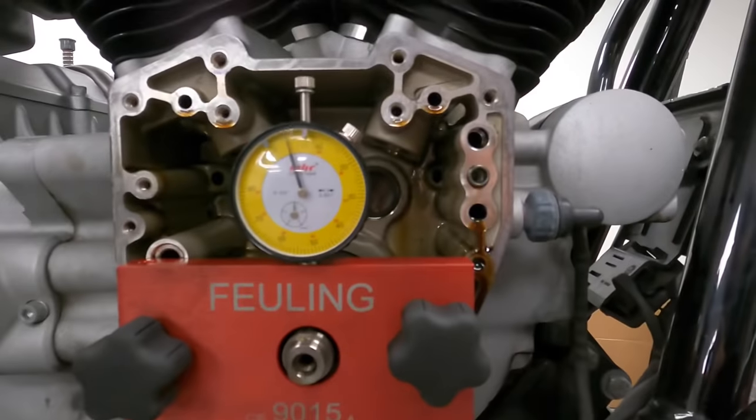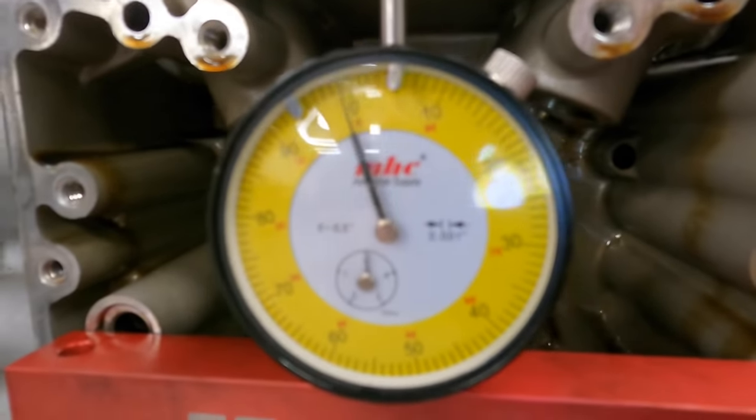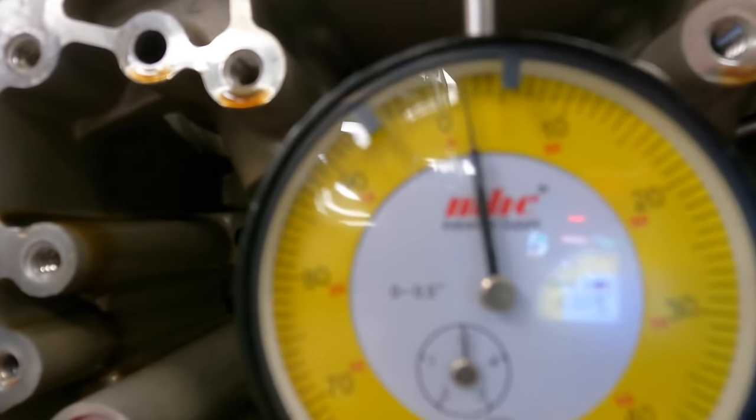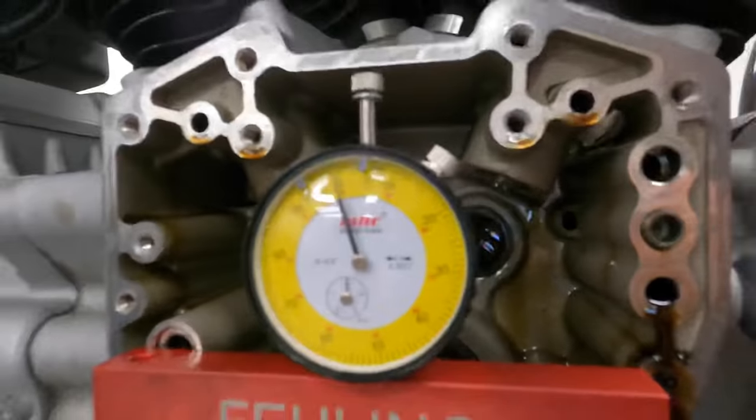This is to check pinion shaft run out — it tells you if the crank is true. That's why I took the spark plugs out and put it in 6th gear, so I can rotate the motor over with the back wheel very easily. This tool is not very expensive — a couple hundred bucks. If you're going to open your cam chest up at any time to do anything at all, you should check the run out on your crank. I'm going to set my dial to zero. Spec maximum run out is 11 thousandths in the case. If you're under 11 thousandths, a lot of guys will say your crank is out by 6 thousandths and try to hustle you into changing it — they're lying to you. Looks about three thousandths. That's goddamn good.